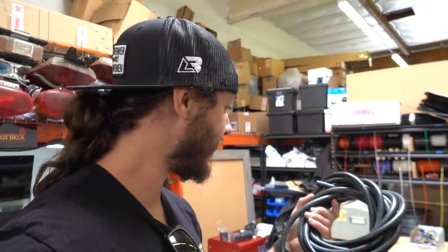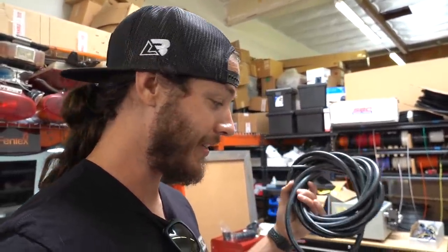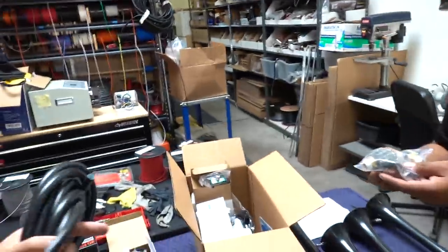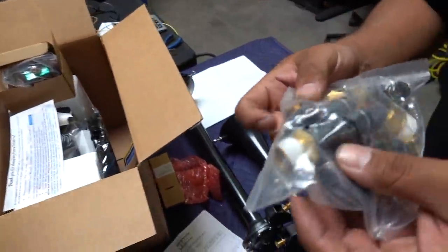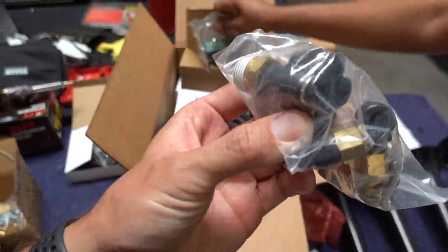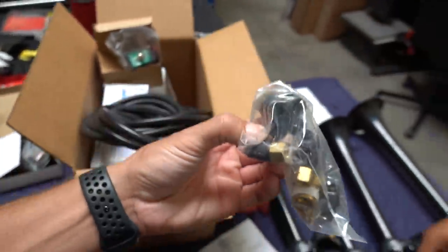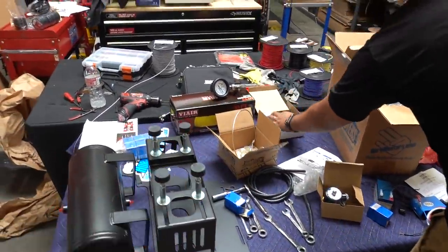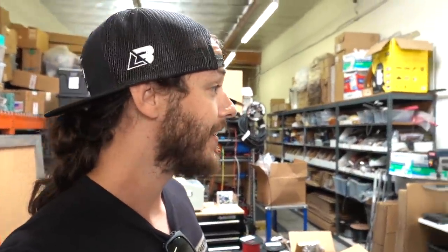The airlines they include — these are half-inch airlines. Obviously the bigger the airline, the more air you're going to get to the horns, which is usually a good thing. The more horns you want, the more air you need coming out. There's a lot of stuff in these kits — they kind of give you a grab bag of fittings. There's a little manifold that splits off from one output to four to run for the four horns, a lot of little bits and pieces that go into these things.